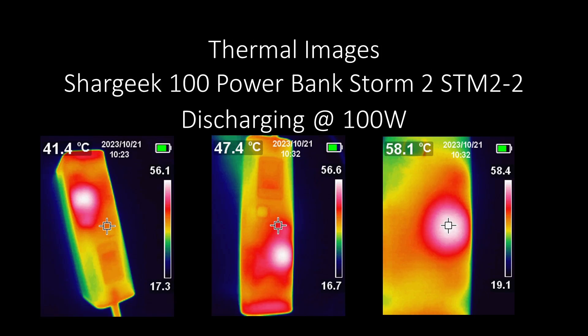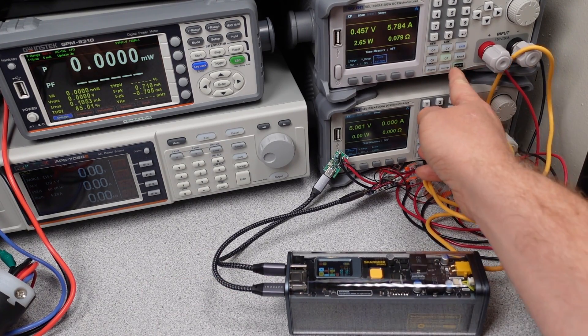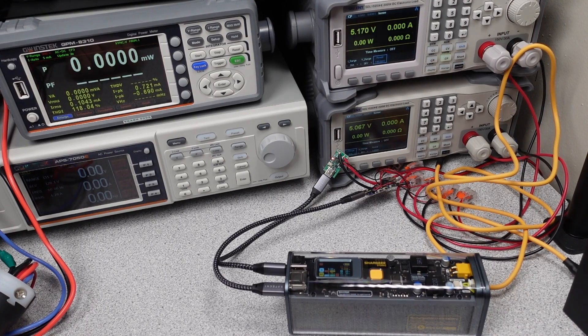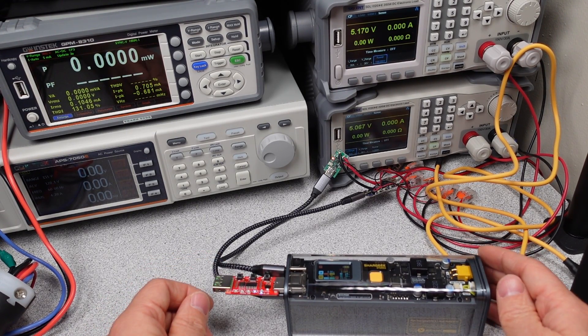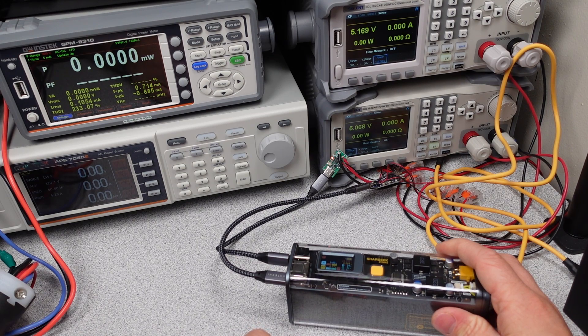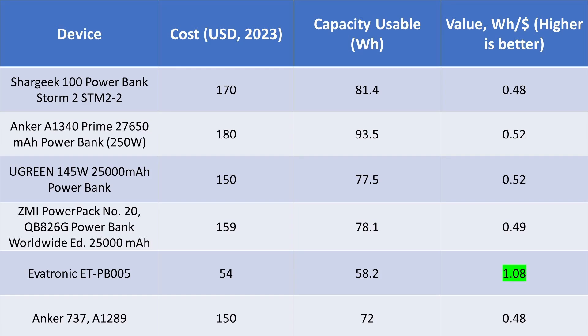The power bank did have some renegotiation time and sometimes operated nicely, other times behaved a bit weird during the plug and unplug process. I tried various devices and plugs and unplugs. The USB-A port shuts off with the other USB-C port being used, but it isn't supposed to do that — not sure if it does it all the time. I could see this being an issue with some other devices on the market creating power loops. The 100 watt port drops to 65 watts with the use of the other ports. In terms of value, this ends up near the bottom of the scale. This power bank is expensive — less expensive than it used to be, but still priced at the premium end of the market, and it's an average performing device being sold at the top tier price point. It has a unique DC output feature, but getting a cable is still required to connect to your other devices, so I don't see this as a value add. It also disrupts the USB-C functionality, so I don't know: value add or value detract — you have to make that decision.